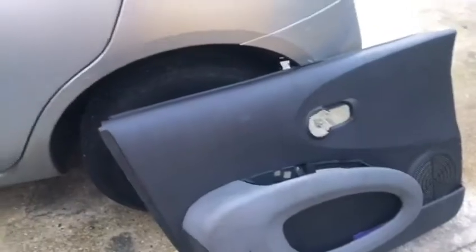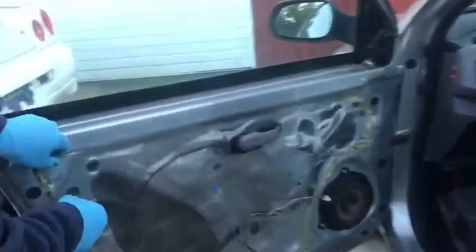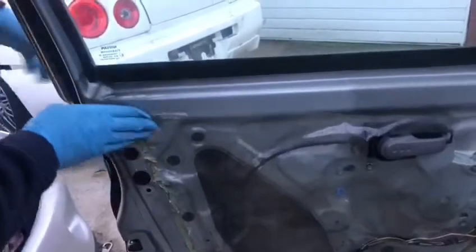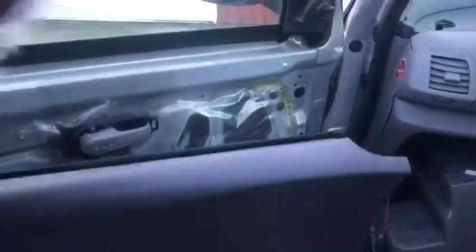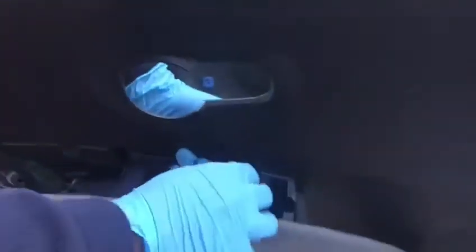Now we're going to put the door card back in. The door card will go back in just the reverse again. So make sure we get this plastic part back in. Okay, so bring the door card. Just to remind you guys again, there is just one screw that's holding the door card. Apart from that, you've got these clips that are going around the door card as expected. Before we do that, make sure you get this wire through here. This is for the window control mechanism. Right, in reverse, because we pulled out the last one from the top, so we push it from the top first. So make sure you line it up.